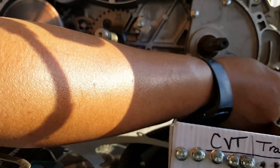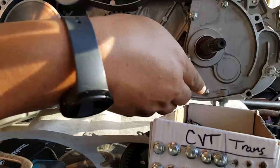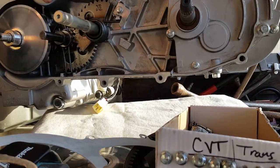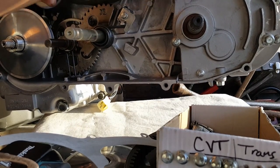The drain hole is a 10mm, which we don't have to remove. All we have to remove is all these — the rest of the six 8mm bolts that are holding the transmission gasket. So here we go, I'm going to remove them. You can see here, it's coming on quite nicely.